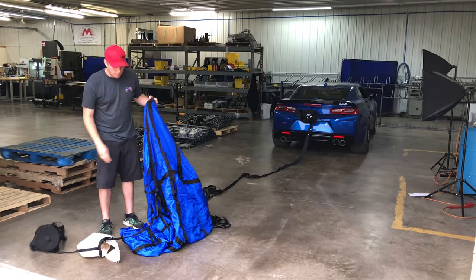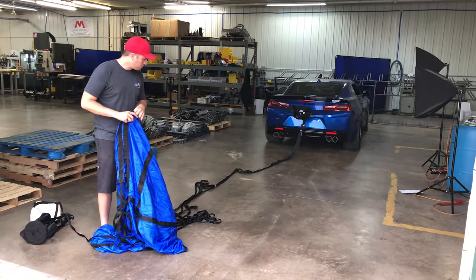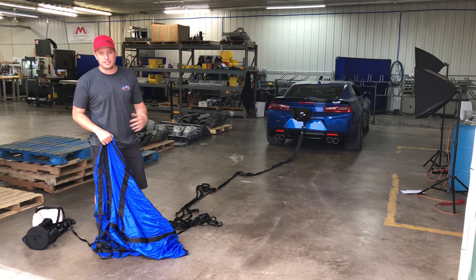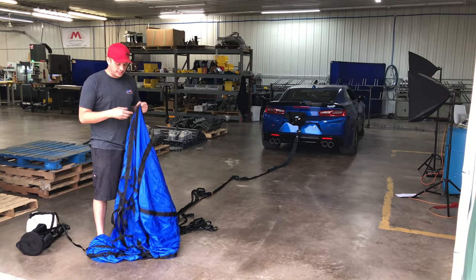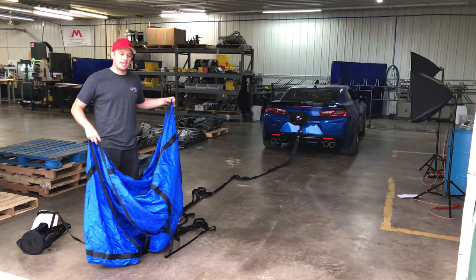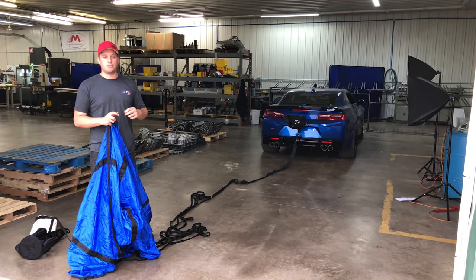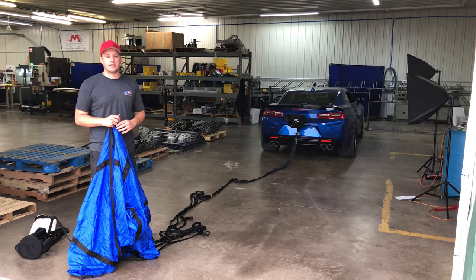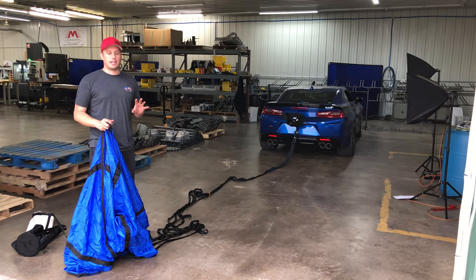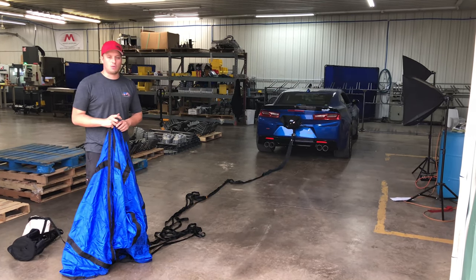This is pretty much about how a parachute is going to look when you're done with it, if you pack it up properly. Now, this car uses a 430 chute — it's heavy, like a lot of these door cars are, but these chutes are all built the same, they're just smaller. If you have questions on sizing a parachute properly, I have a chart down below that shows at what weight and mile-per-hour what chute you should be using. Anything over 200 mph gets dual chutes, and they are different than the single chutes in size. If you have any questions, give us a call — we're always happy to help.